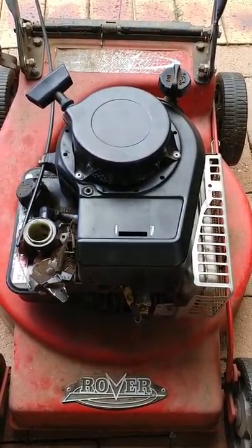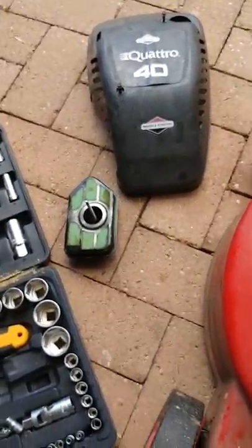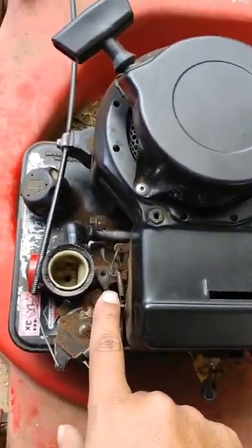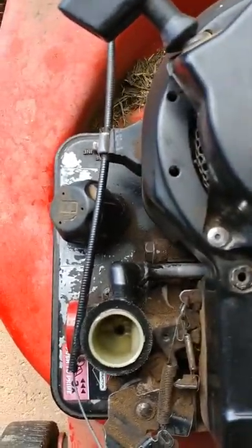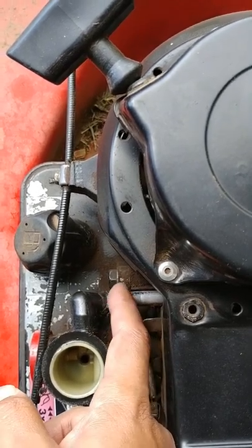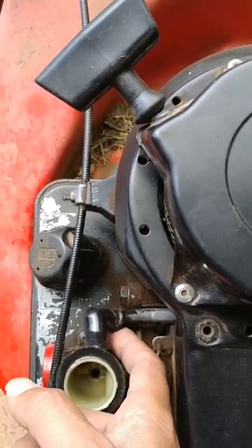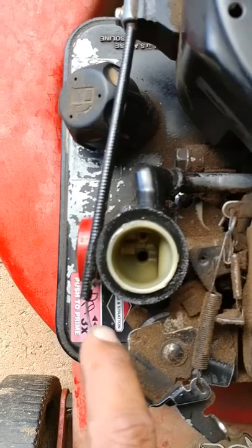I've taken off the cover - as you can see, the cover's over there and there's the air filter. The engine is exposed and the carburetor is here. Over the course of 20 years I've had to maintain it. One thing I had to do was put silicone on this rubber hose because the rubber hose is a little fitting - it stretches, and this is a blow-by hose. I put silicone here to stop dirt getting inside and causing an air leak.